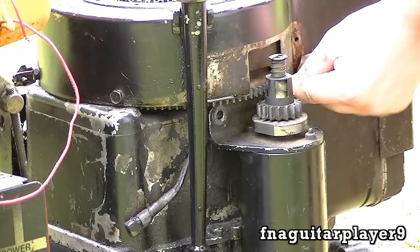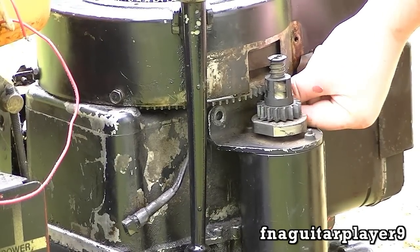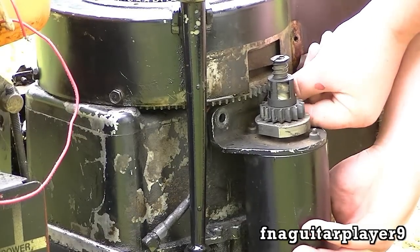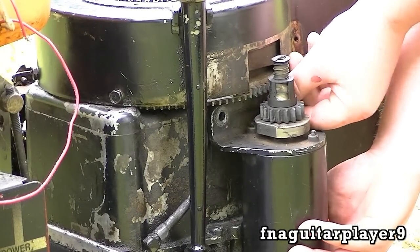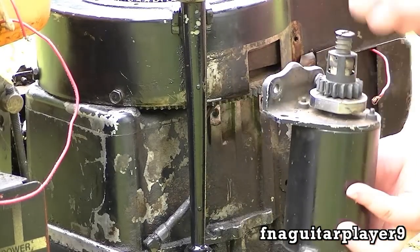You're probably thinking you can use a ratchet wrench over here, but it won't fit — you've got to do it by hand. It's usually best to hold the starter here to loosen it so it doesn't drop. Take the bolt all the way out and there it is.